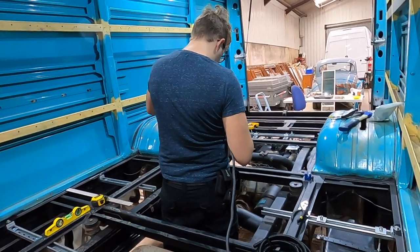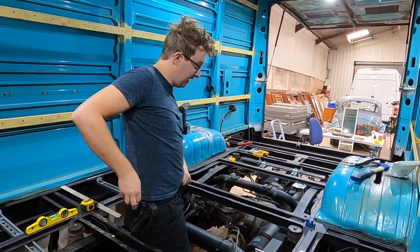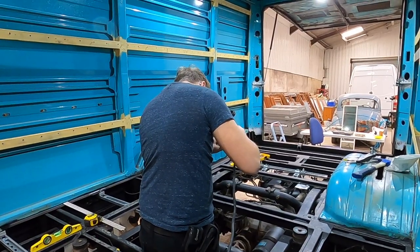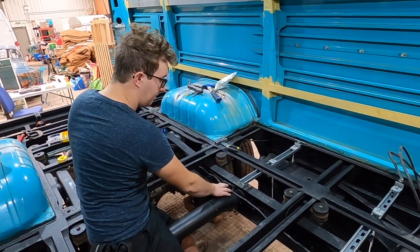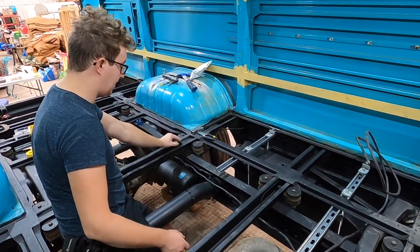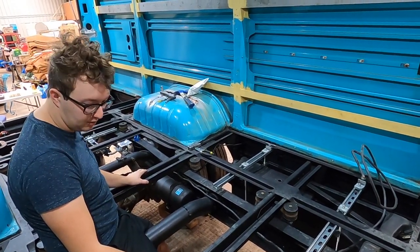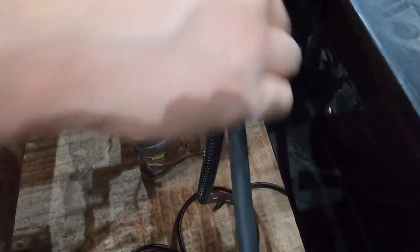Right now we're fixing the end of the copper pipe and then routing the copper pipe to where it's going — attaching it in place and just leaving the end so we can add the connector when the new connector arrives. We've roughly routed our 8mm copper pipe for the gas system from the regulator along the chassis where some other cables are running, and then across to the side where the cooker is. We've roughly bent it into shape by hand because it's nice and flexible, and now we're going to put it inside our conduit and attach it into place.